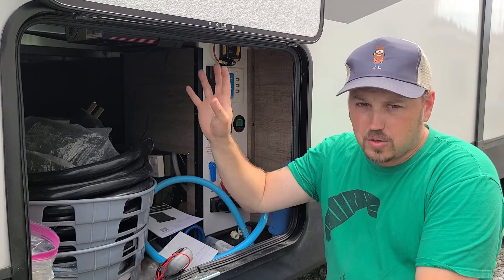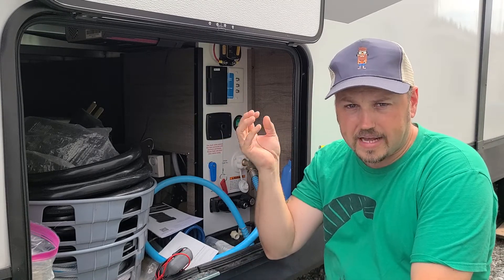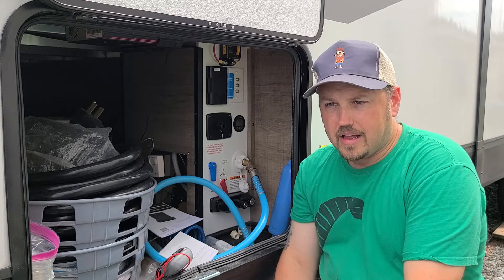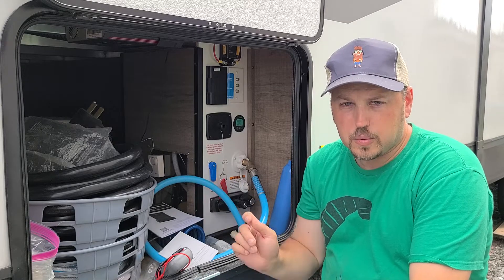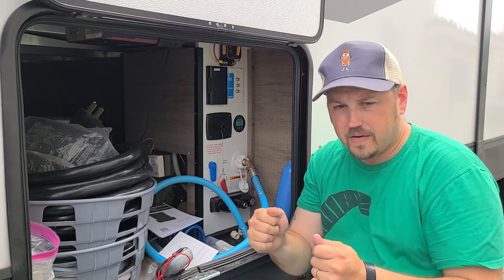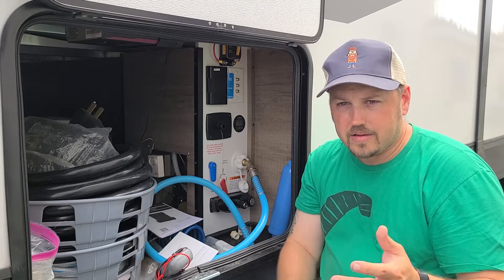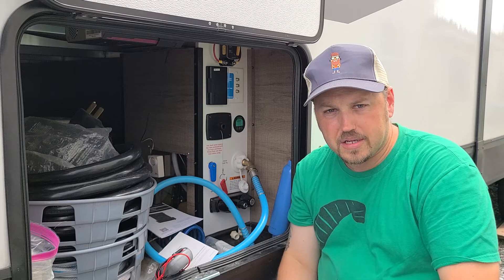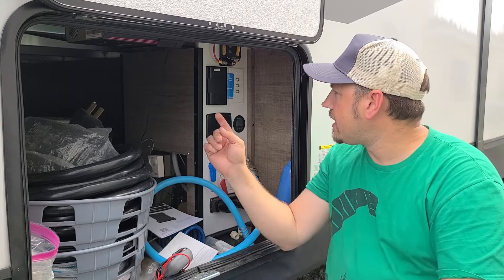Right now that switch is on, so my batteries are connected to the system and my solar panel can charge the system, because there's always voltage coming from the panel down to the charge controller whenever there's enough daylight to produce a charge. That's where that optional disconnect comes in — if I needed to do something on the 12-volt system and I didn't have that battery disconnect, when I took off the leads they could be hot, getting voltage from the solar panel. My dealership told me: when you take them off, cover them and tape them, because the panel is always putting out power.